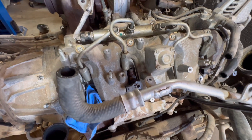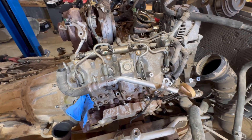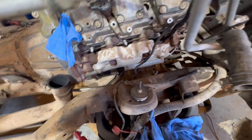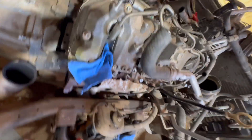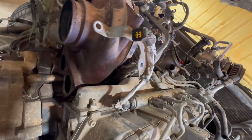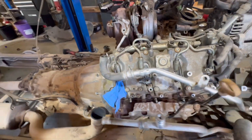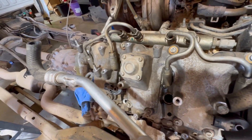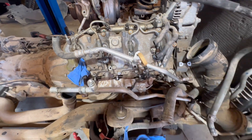It's a lot cheaper and easier now than it would be later. We'll just work through everything one thing at a time. Right now we're working on the fuel side — get those injectors sent off, because it takes about a week or two on average to get them back. Then we'll stick them back in. Glow plugs are already in on this side. We'll put the up-pipe and downpipe back on. Turbo has no play, turbo is fine, so we're not going to pull it now — just leave it.